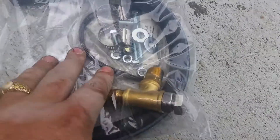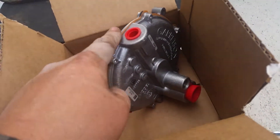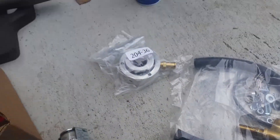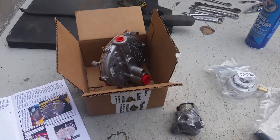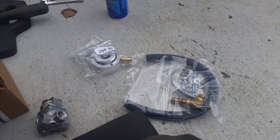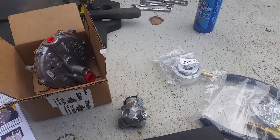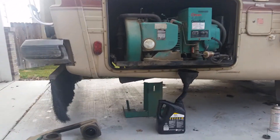That's as simple as it gets, folks. This is a low pressure kit, by the way — not a high pressure kit. They've got two completely different kits for this. They only give you the kit from the regulator to the carburetor — that's your whole kit. What you have to do to plumb into the propane on your RV or your application is up to you. With that being said, I'll stop the recording here and you'll see the rest when it's attached to the carburetor — or at the very minimum I'll do an update video.